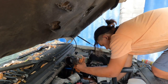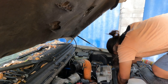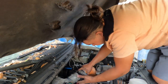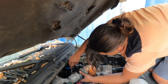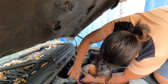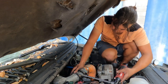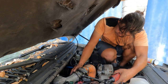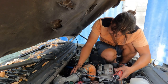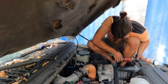There's a lot of stuff there — you might have to guide it. Slide it onto the intercooler. Press the top down, grab the pick, run it around the silicone boot, and boom — right onto the spider. No biggie, easy peasy. I'm not using OEM clamps here so that's a 13mm socket, but I believe your OEMs are 12s. Don't over-tighten these — just make sure they're good and snug. A lot of people kill these clamps; you can screw them up that way.